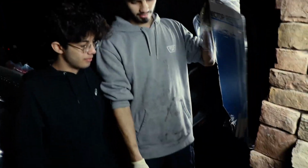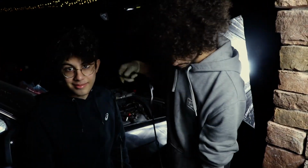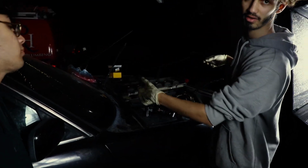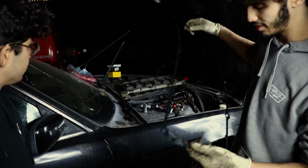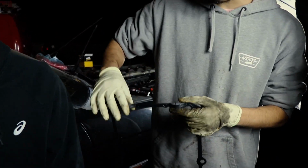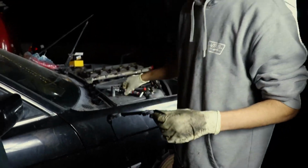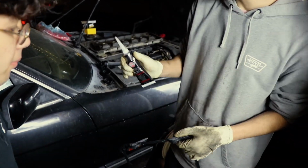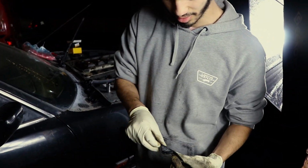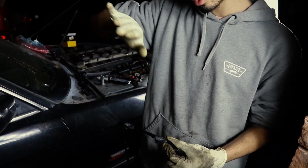This is our valve cover gasket, and this is gonna go on the studs on your valve cover, right? So it guides pretty easily. Here though, we have this rubber piece, these two circles, these indentations. We're gonna use some silicone on the valve cover to help seal here, because this is kind of a difficult seal. Just a really weird transition from flat to curvy.